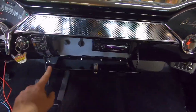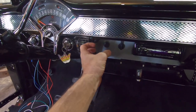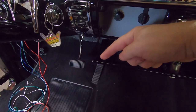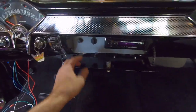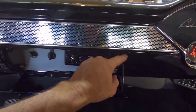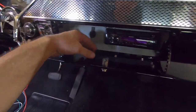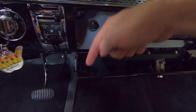The glove box door is actually extended. Originally these have an ashtray right here that flipped down — I removed the ashtray from its main rear piece and welded it to the side of the glove box door. I modified it with sheet metal so it has the fold all the way around, making it look like a factory glove box door. I took the divider out and fabbed up a piece to look stock, so it still takes the little rubber cushions so the glove box doesn't rattle. I re-sheet-metaled the whole back of this glove box.